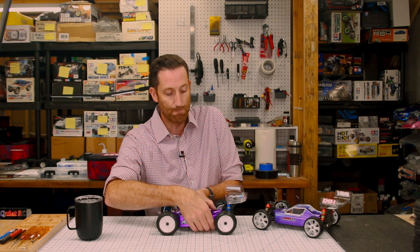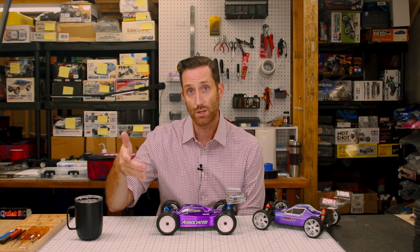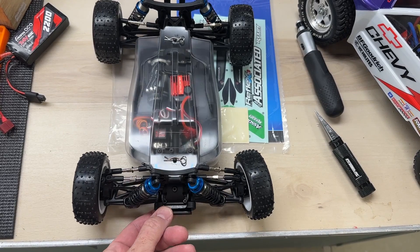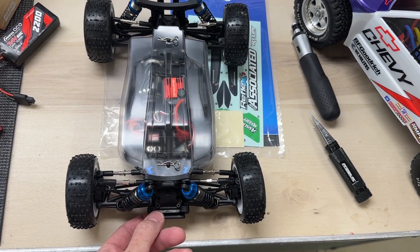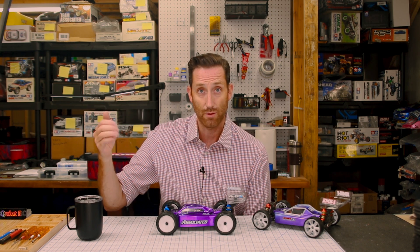As you'll notice, I'm not using body clips — I'm actually using Velcro. That's my personal preference, coming from the fact that 10th scale buggies tend to have Velcro-mounted bodies because it just keeps it a lot more solidly on there. One mistake I made was installing the front turnbuckles from the steering upside down, so when I pressed down it would do a crazy toe-out thing. I just had to flip them around the other way — obviously I was distracted by all the other issues with the manual.